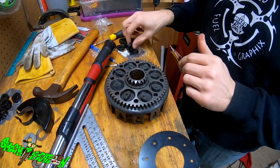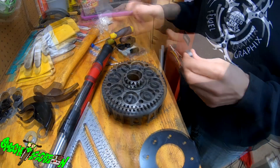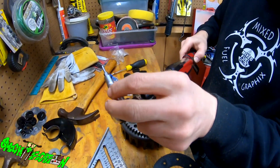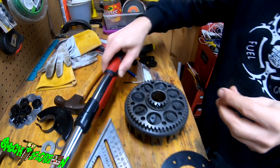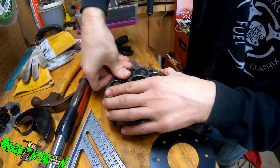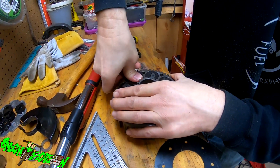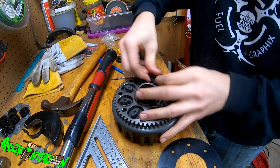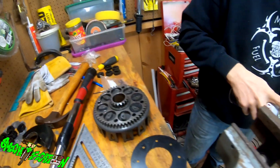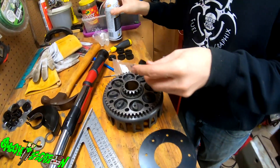This piece just lays on there and then these go right in there, so I'm going to press all these in. The new basket came with the screws and this little end piece to put your screws in — they get torqued down at 9 Newton meters. I might spray one of these with a little bit of silicone and see if it goes in any easier.